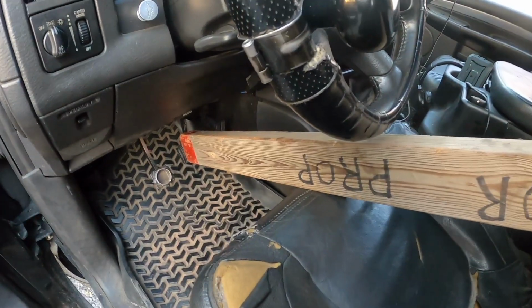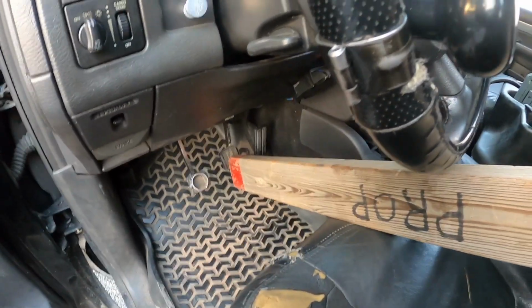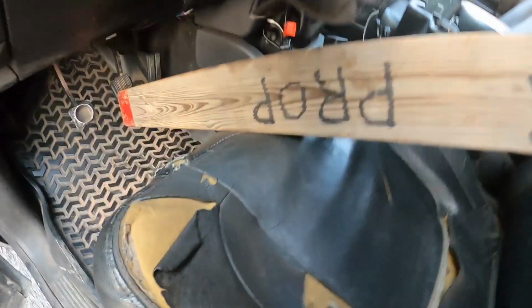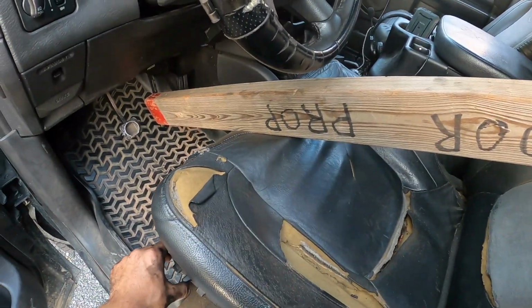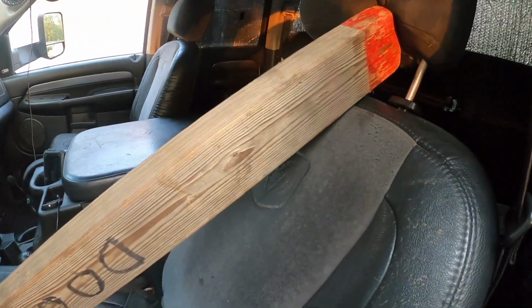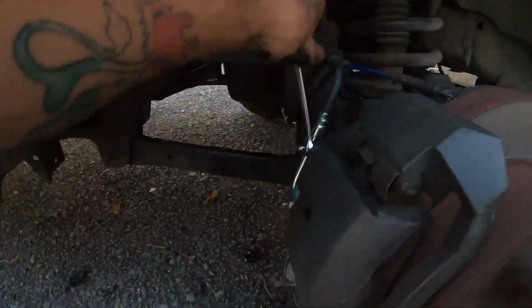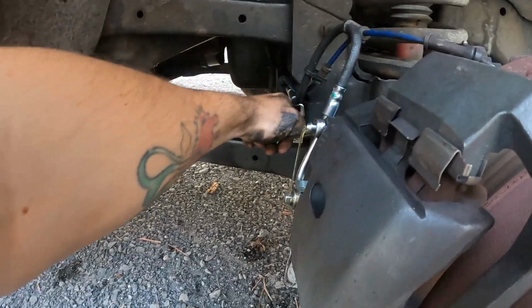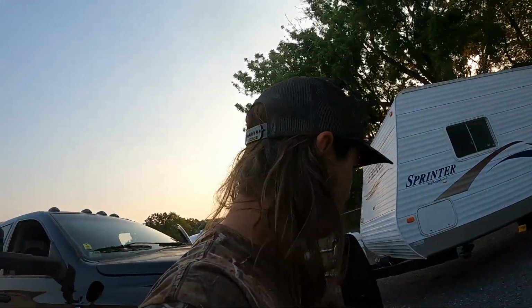Basically, you know, give her a couple good pumps. Stick them under there, and then there we go. Give them a couple good pumps, and then we'll let the bleeder screw off. See, you gotta improvise, because I wasn't sitting here. Listen to this. Oh, look at that, no air. We are golden. Let's throw the wheel back on, clean our mess up.